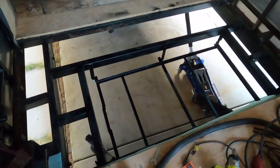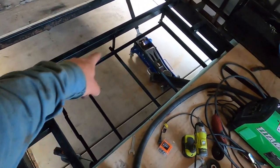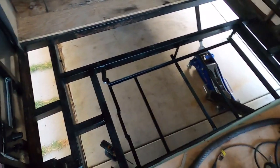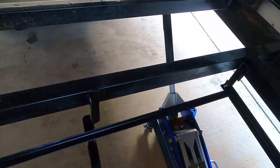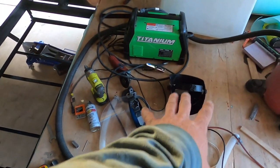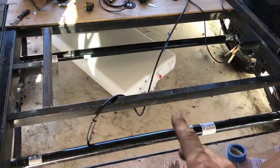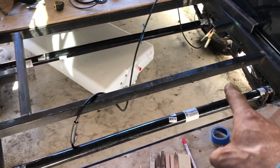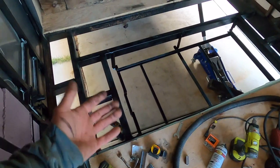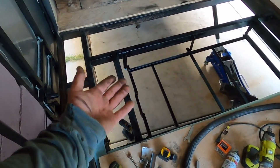Finally got my fresh water tank mount made and installed — it's all bolted in now. Six bolts. Originally I cut the frame right here over the axles and I was going to mount the water tank between the frame right above the axles, but I realized it was hanging too low. I just didn't want the axles to hit the support.